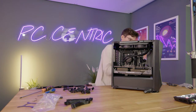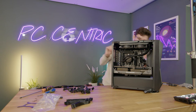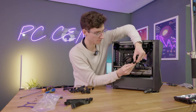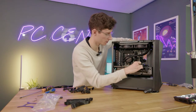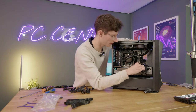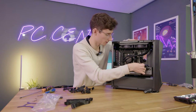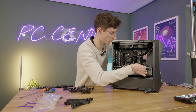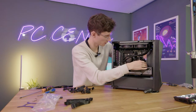And then I think the final thing to do is not drop screws on the floor. Final thing is to plug the GPU in. Which should be fun. So remember what I said, you don't want to daisy chain, but I'm personally happy to daisy chain one of them because you're not going to be using the full amount of power across both. Whereas if you were doing this on a 2x8-pin, then you might run into issues where you've not got stable power. But reminder that we're using 3 8-pins, so two of them are going to come direct from the PSU. I don't have a problem recommending that, but if you're concerned, obviously, then just use 3, because this does come with 3, so you can do that.